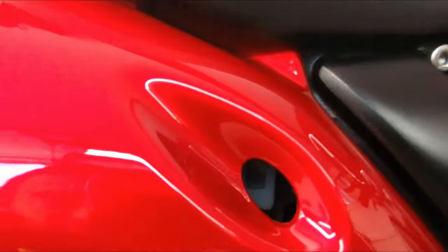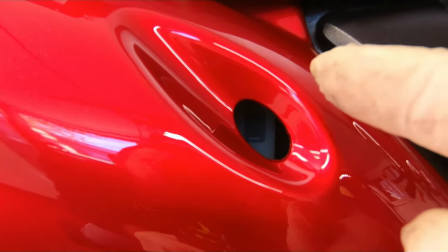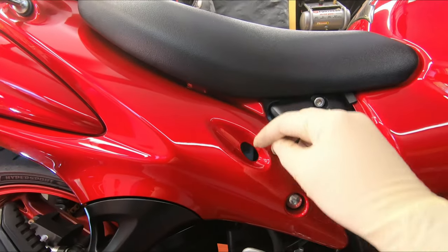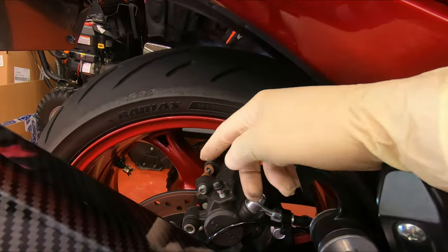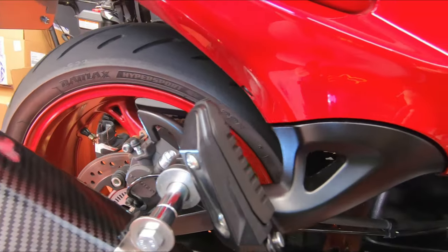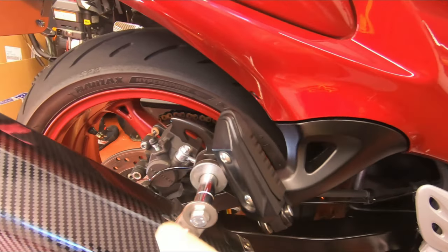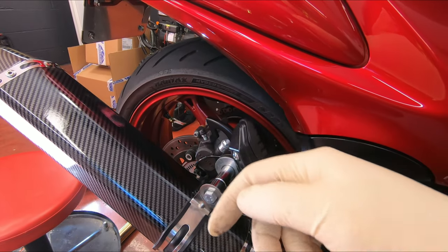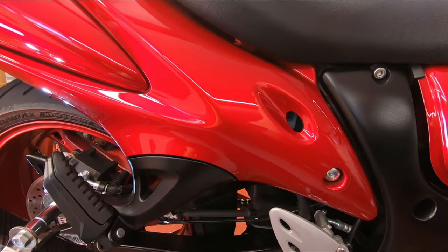Now you want to make sure — if you have too much brake fluid, you could suck some out from the reservoir. It is kind of extra work to remove the plastic to get access to the reservoir. You can also bleed the brake from here to remove some excess brake fluid, but that's only if you have too much. Mine was on the bottom before, so after forcing the piston in, my brake fluid is back on the top. In most cases you'll be fine. This is only an issue if your pads were low and at some point you added brake fluid — when you push the piston back, all that brake fluid is gonna go upwards and spill out.